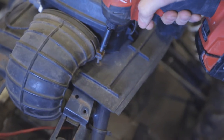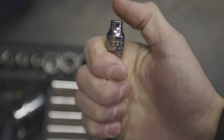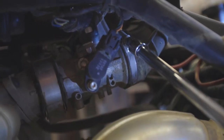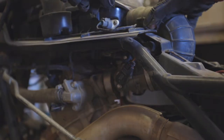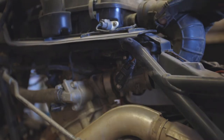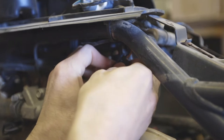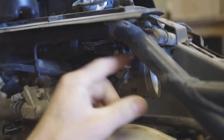Alright, so I've got this little air duct up here. We've got this air duct running from the air box down to the throttle body. We've got two screws on that — that'll pop off. Then we have all the connectors on the throttle body, all those plugs. You can pull all those.